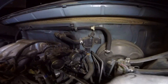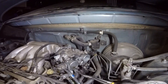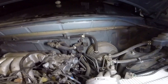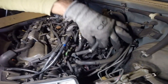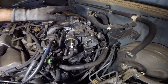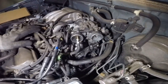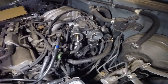That's the coolant line — I have to plug it. I plugged the coolant line along with the spark plugs. Now I need to remove the whole throttle body. I don't have to remove the cables; the whole thing can come off and be set to the side.